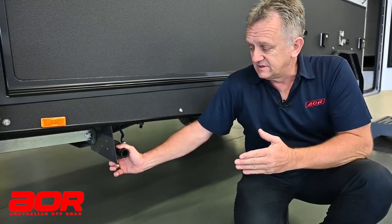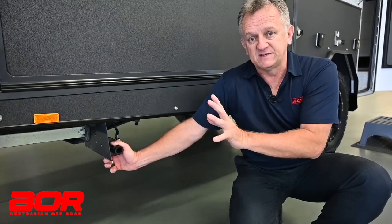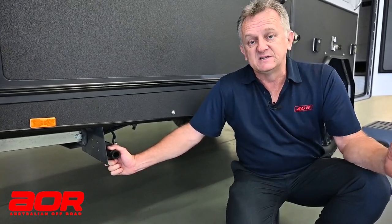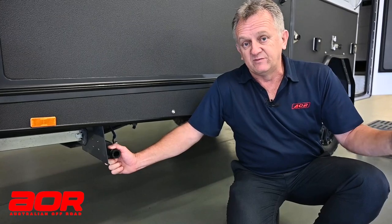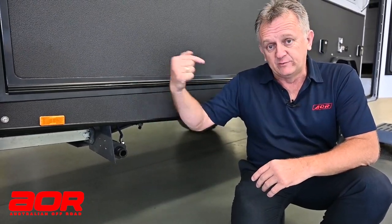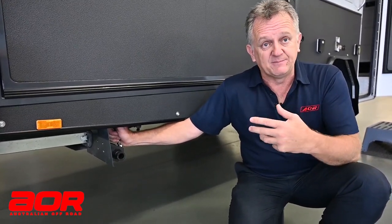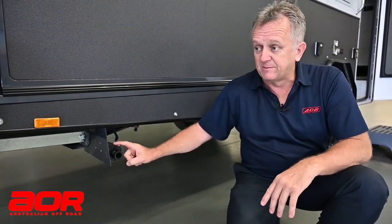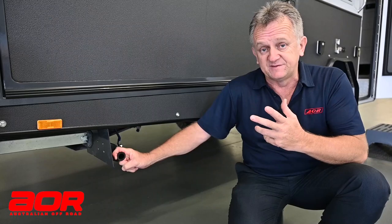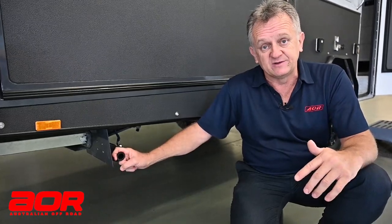A lot of our customers will do this where they empty this onto the garden. You've already cleaned the bulk out of the tank at the dump point — now it's basically a clean system, but you want to get the last of it out. Bring it back home, put it around a favourite tree or whatever, and let any minimal residue come out. That is cleaning the system in both normal operation and in reverse for going into storage mode. Shut the valve down, disconnect the tap, and it's basically shut down. Best to leave this gravity side to last — shut the other valve, turn the tap off, and let this dry until you see no residues still dripping out.